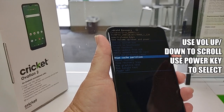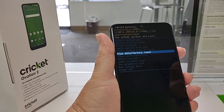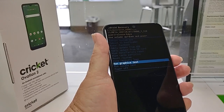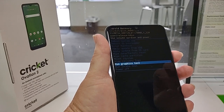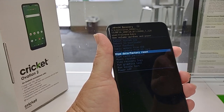Do that first, then restart your phone. If it's still lagging and still messed up, then you might want to do a factory reset — wipe data factory reset, right there. You can also run tests like a graphics test to test the graphics if your phone's messed up, but again if you don't know exactly what you're doing, please leave that alone.